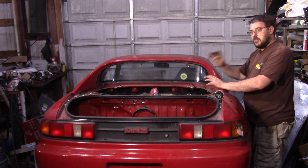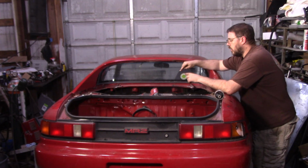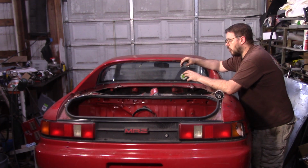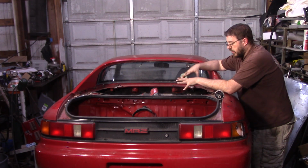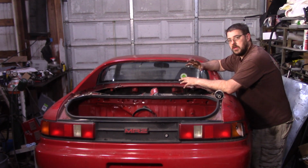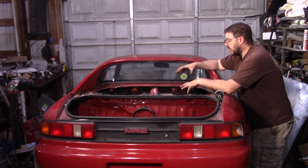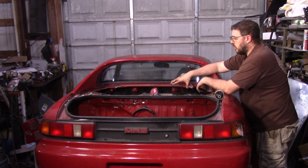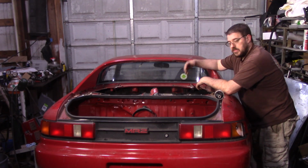Now, what I don't know for sure is, are we going to need to go with the larger displacement to get that? Or are we going to need to go with a higher compression to get that? But either way, we're not going to need to do both because both is not available from the factory. And if it doesn't get it in this form, then I'm actually going to throw it in a 2AR-FE first, because that's much cheaper to get.